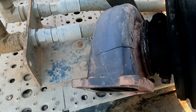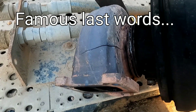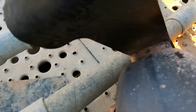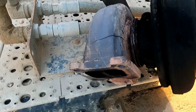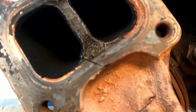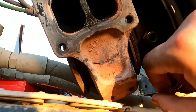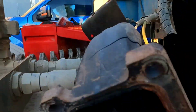That's where our high-pitched whistle was coming from and where our exhaust leak was coming from. The turbo spins freely and seemed to be working fine, but that is definitely the source of the problem. I'm shocked and very happy it was the turbo and not the exhaust manifold, because I'm having a hard time tracking one of those down. It's kind of amazing that it cracked without cracking the exhaust manifold — that's very good news. Looking inside, you can see the crack on the inside as well. There's a crack right here and a crack right here — this thing just took a beating.